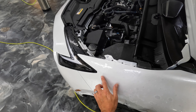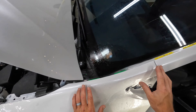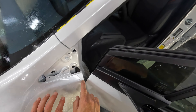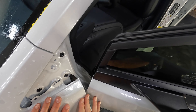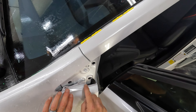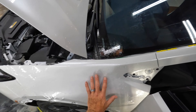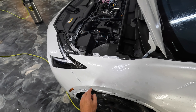I'm just kind of trying to line this pattern up. It looks like this lines up real nice, and then this little cutout also — let's just make that barely hit the edge. We've got some good coverage for everything that's going to wrap up in here. Let's go ahead and tack this area down, and then we're going to stretch to the front here because it looks like it's going to need a solid quarter of an inch of stretch.